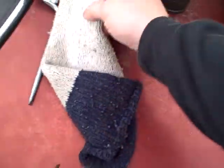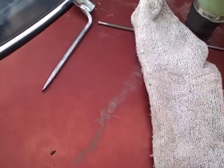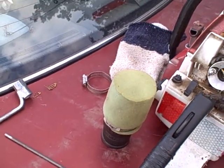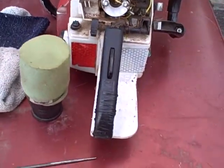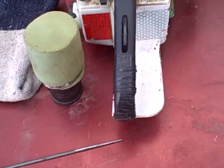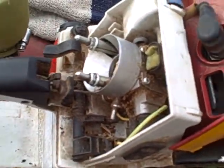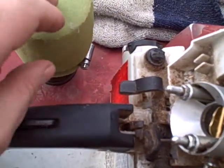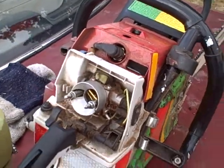I don't really like these green filters — they work but they're not the best; this one's going to be junk piled. What I do once I replace that green filter is use just a common insulated winter sock. You can just use these — they get rid of a lot of the big chunks. You can oil these with motor oil, even gear oil works. But you've got to make sure they're pretty dry when you wring them out. I recommend using a good WD-40 to spray on there — you've got to spray it every day if you're using them real heavy. On this saw the studs are pretty long. You can see one thing I don't like on these green filters is how coarse they are — I'm not impressed with that material, it lets in a lot of fine dust. I need to spray it out with some carb cleaner just to get all the junk out of it.